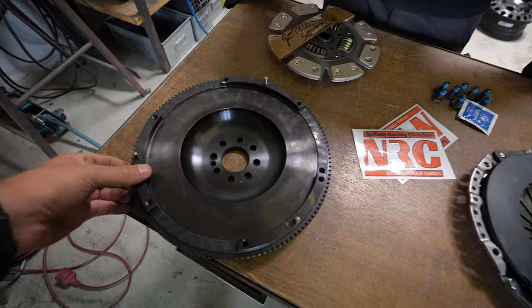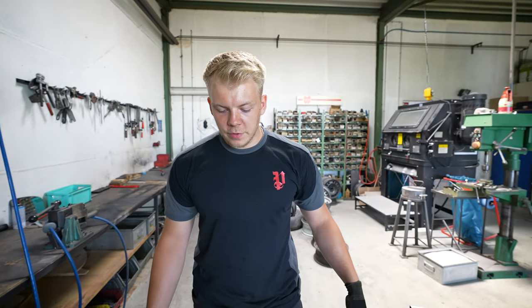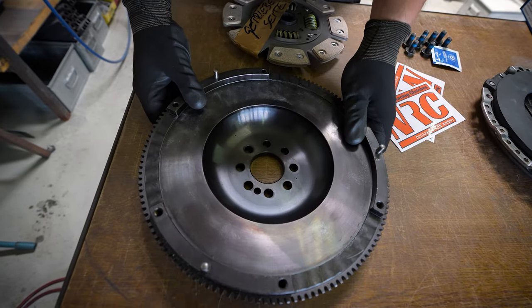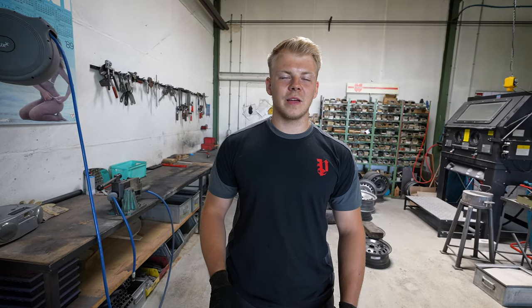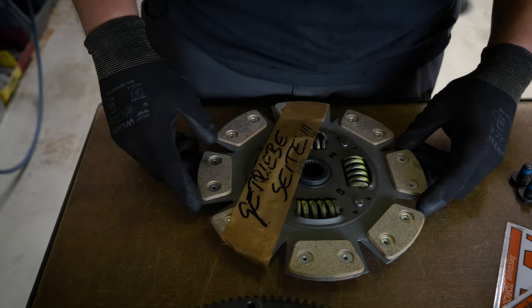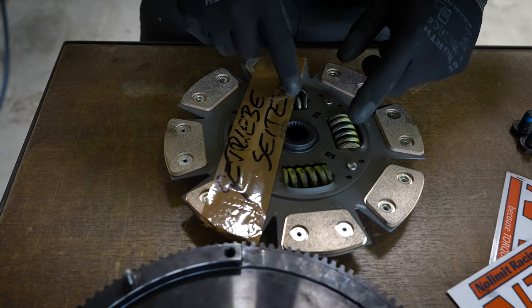And Benny - I mean BK Performance - he built the best because there is no problem with it. Here is a difference: this is now a single-mass flywheel. What is the difference between single and dual? A single-mass flywheel is completely rigid and stiff. The dual-mass flywheel is flexible, so that when you engage the clutch and let it out, it makes for a soft start. But with the new clutch you compensate through the pressure plate and the clutch disc, where the clutch disc is then spring-dampened.